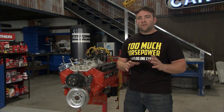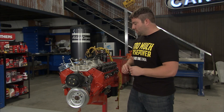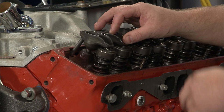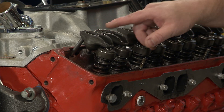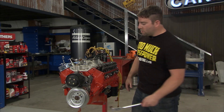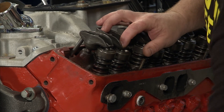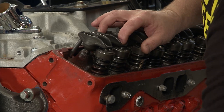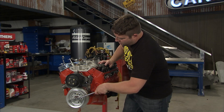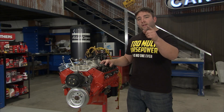We need to know where the piston is at relative to the combustion cycle. The easiest way to do that is to locate the intake valve for number one piston. We want to follow the air and fuel mixture through the intake manifold down the port and it lines up right with our intake valve for cylinder number one. To double check this we're going to find the exhaust valve, which is lined up perfectly with the exhaust port in the cylinder head. So the next thing we want to do is rotate the crankshaft and watch the valve open. There we go — the intake valve is opening, it's letting air and fuel mixture in, and it's closing. You'll notice there's no movement any longer in this valve spring or the rocker arm even though the crankshaft is still rotating. That means the piston is on its way up and ready for the combustion event, and now you're ready to set initial timing.